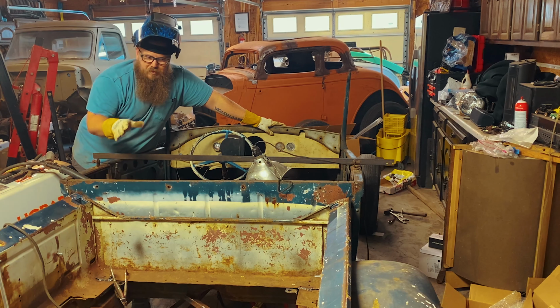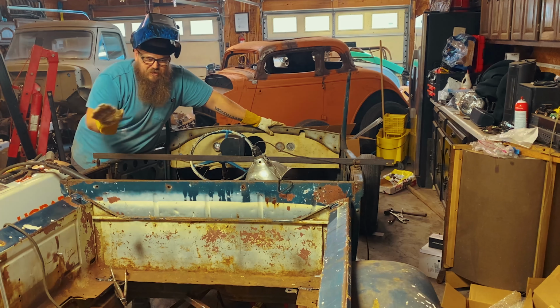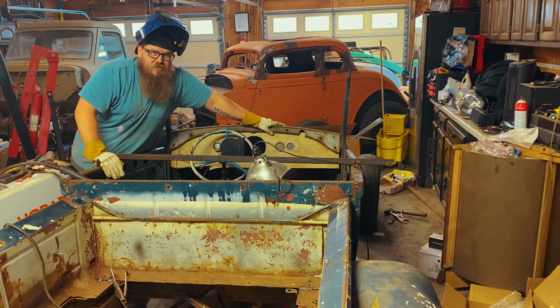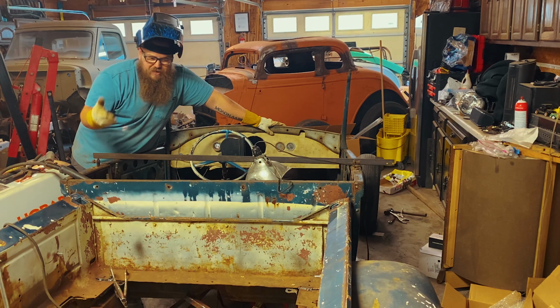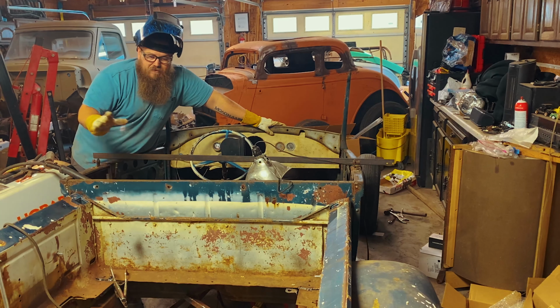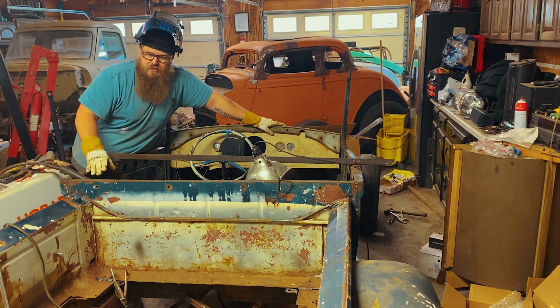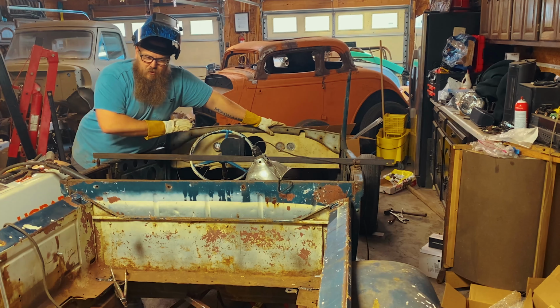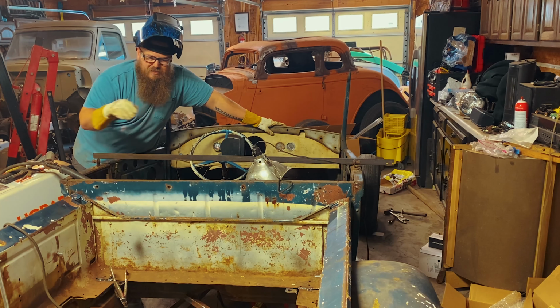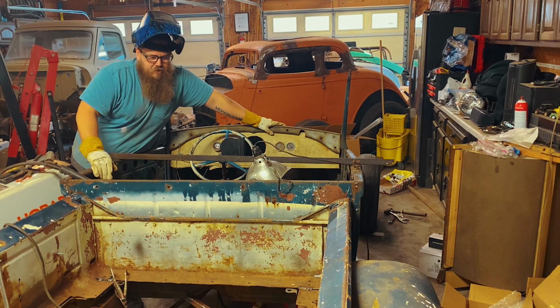And I'm probably gonna bring the floor up in the bed quite a bit. I'm gonna use some square tubing, then I might just 11 gauge the whole floor, just one flat sheet. It's pretty heavy, but if you think about this truck, this bed, this floor, this thing weighs nothing. Getting a little bit more extra weight in the back is probably a good idea. And that whole thing's gonna get covered with a pleated cover. Then the floor will be pleated also. So I wanna pleat this thing to death. That's the idea, just a little bit of fun that way. So when you open up the pleated cover for any reason, the whole floor is pleated as well. So there's no reason why I need to do fancy bead setup, 16 gauge, 20 gauge with a bunch of beads all over it. I'm probably just gonna flat sheet it with some 11 gauge. I have plenty of that, so that'll give me my strength.